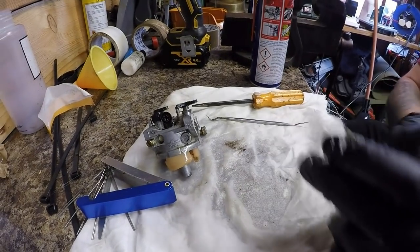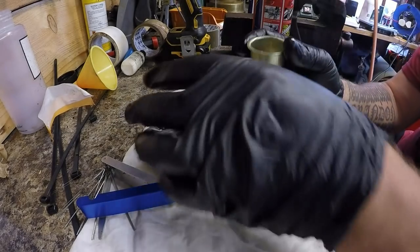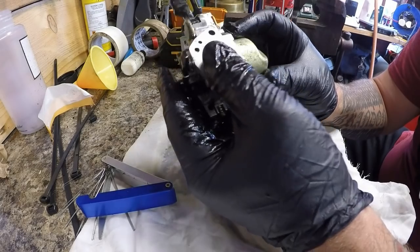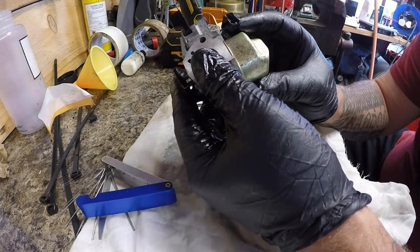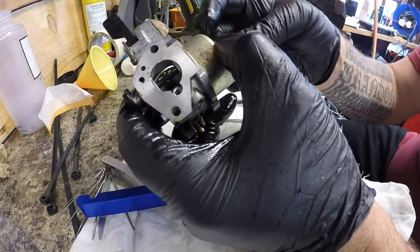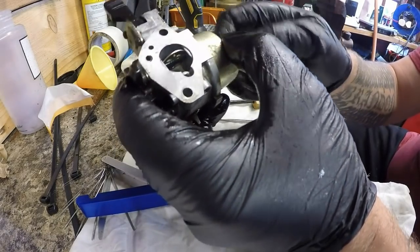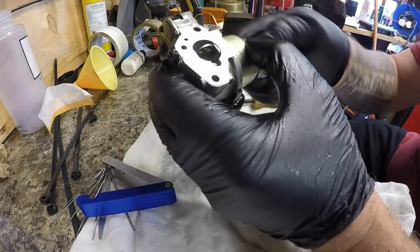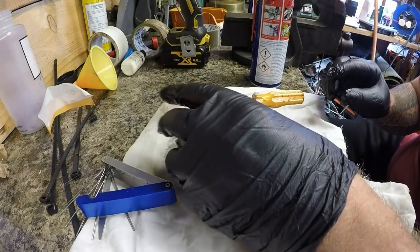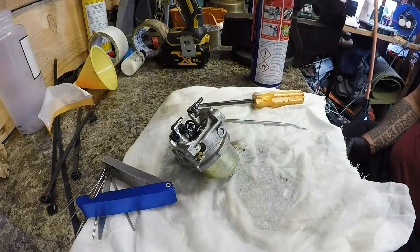I hope you can see a nice close up now, because you are really close. That goes on there like so. And then that one tenner, don't over tighten these because you'll strip the whole threads. I'm actually using a spanner to do that up. I've got one more to go in yet, but that's the carburetor now clean, and we can fit it back to the engine.